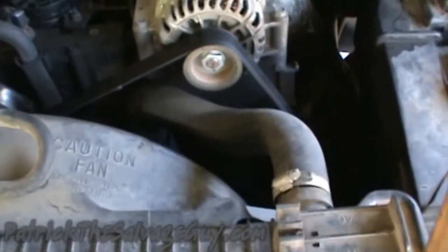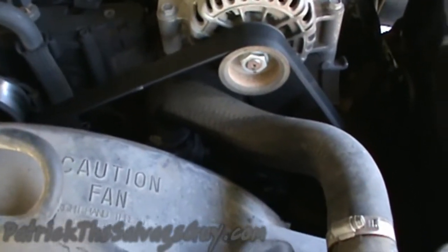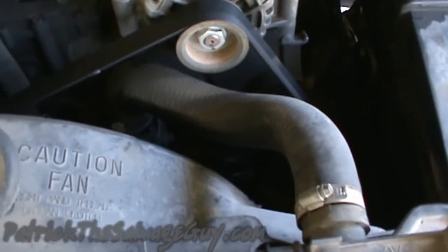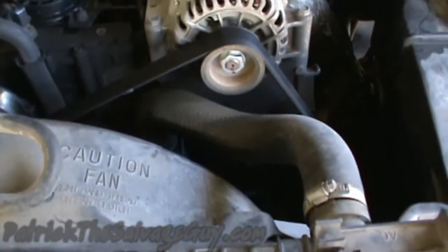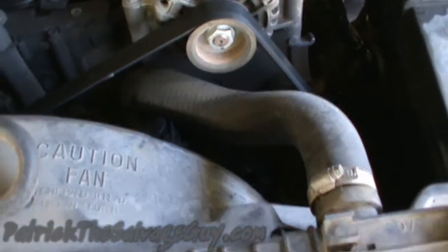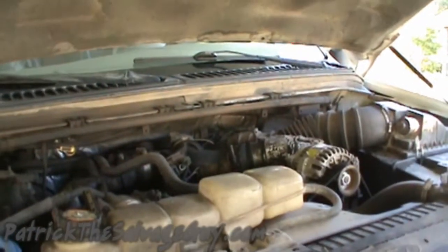Depending on what you've got, there's two different hoses that can go on here. There's a wraparound that's diverted around the serpentine belt. Then there's this one here that goes through it. While that's simpler, if you have to change your serpentine belt, you've got to take off the upper radiator hose too. So I've got a hose that goes around the serpentine belt because, you know, stuff happens where you have to take that off or just change it, and having to deal with the upper radiator hose is a pain when you have to pull the serpentine belt. So here's a fix for that.